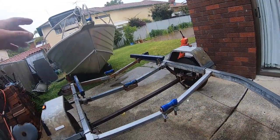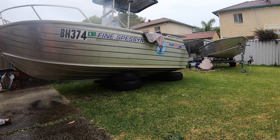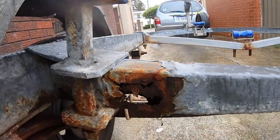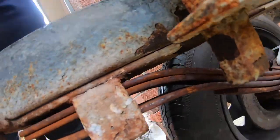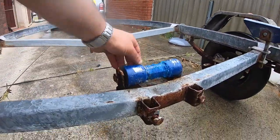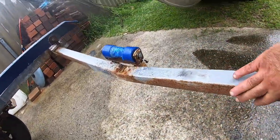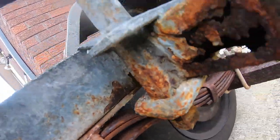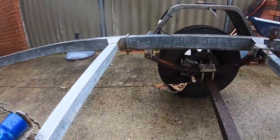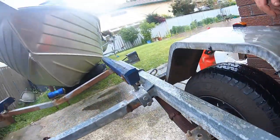That was intense — it is going a bit left, but that's fine. It's been taking me about two weeks trying to work out what to do. Yeah, that won't move. So I'll quickly show you the damage — that needs to be repaired. Look at that rust on the crossbeam, it goes right under it. There's too much on the other side there too. Everything else will be okay, but that probably needs to be replaced, that needs to be replaced. A bit of touch-up paint because that rust is superficial, but that there is dangerous. I'm also getting the hubs done and the brakes — they're a little old and rusty, I can't do it myself, and this needs to be modified.